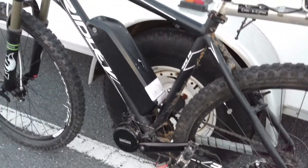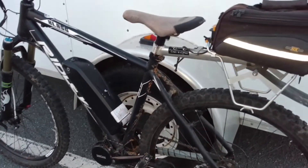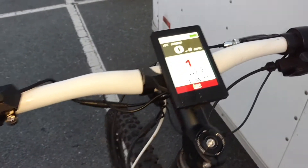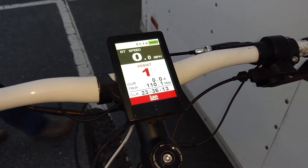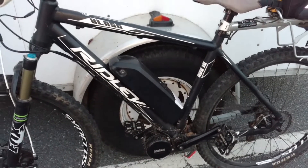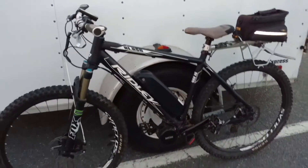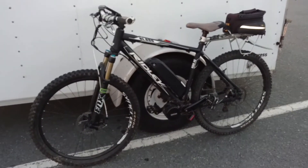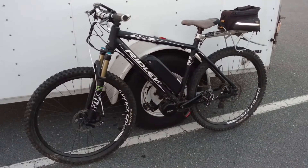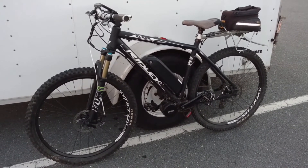It's a machine — this thing will fly. We've taken it out and gotten it dirty on the trails, been on the street, all over the place with this bike. It's a good commuter, it's a lot of fun. One more thing — that's the controller right there. We've got a 1x10 drivetrain on it, which works really well. We put a 46-tooth chainring on the front for a higher top-end speed — it came with about a 30-tooth chainring, but this 46 really does put you in a higher power range.